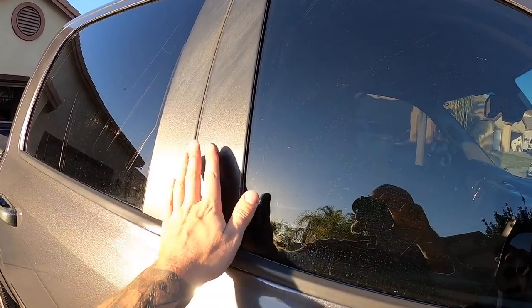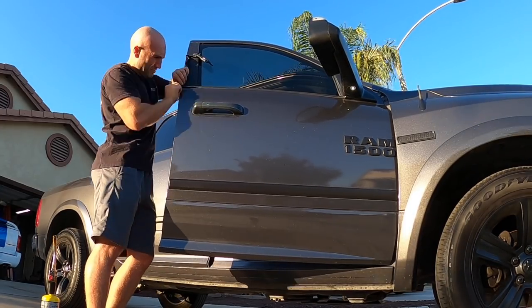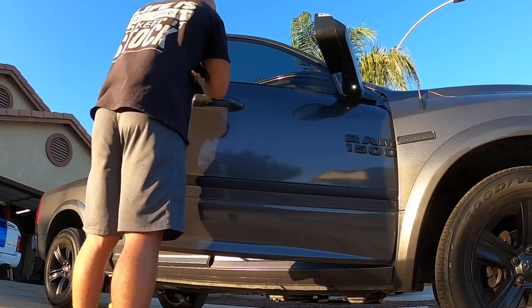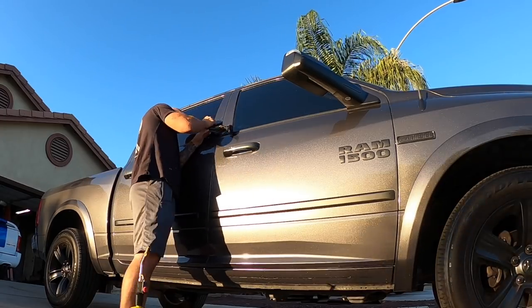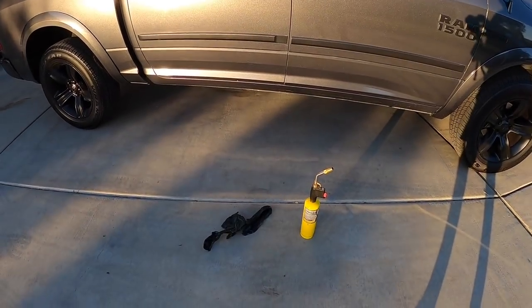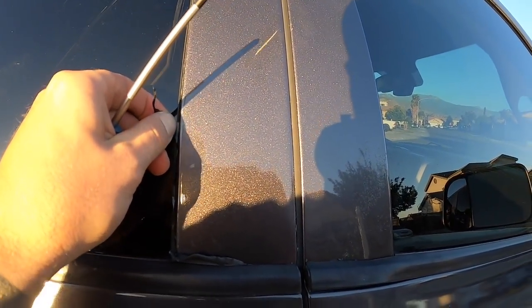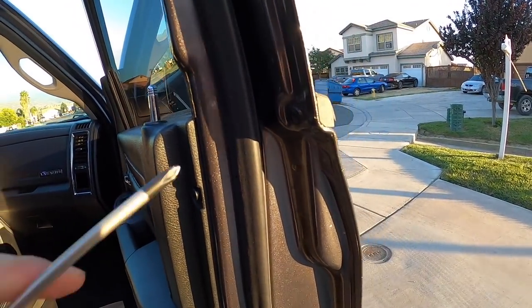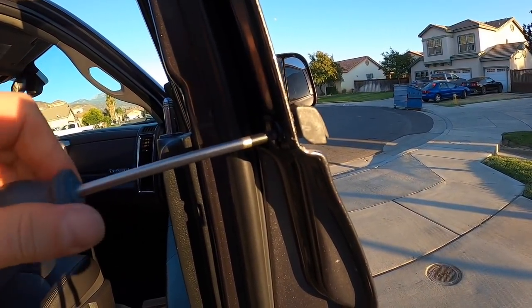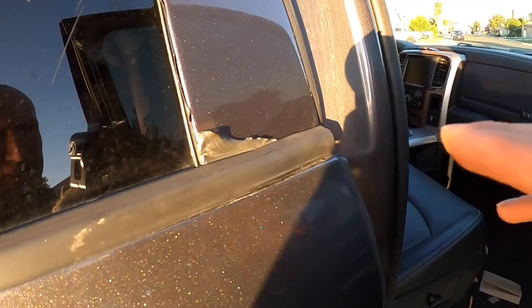I don't have to do any of that cleanup fortunately, but let's tackle the other side. I'm gonna put this side in the sun to heat up and then pull it off. It's off. I used a pro-level heat gun — I do not recommend you try that because it can ruin things very quickly. If you find that yours is getting stuck behind the trim, just open the door and you'll see a Phillips screw right there. Remove it and you can get behind very easily. Out comes the Phillips screw and you can get whatever chunk is stuck back there — same thing on the other side.